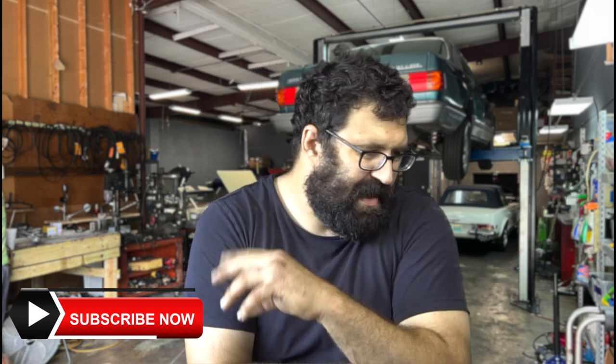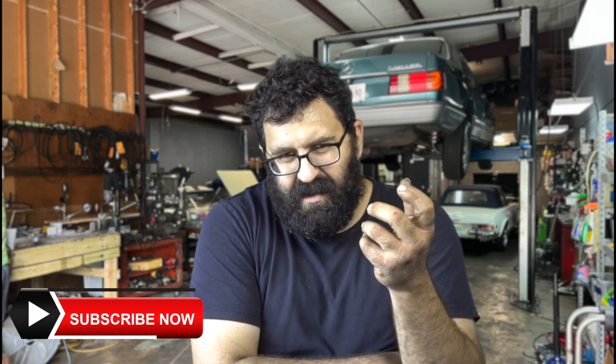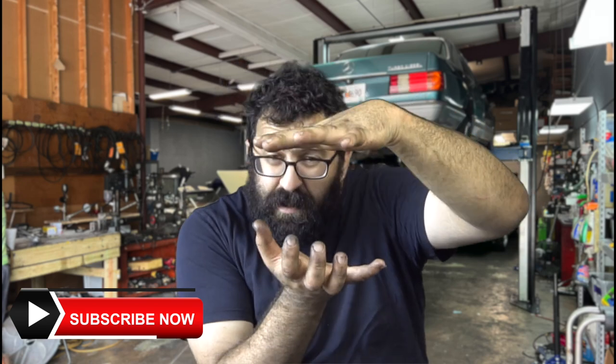We're going to start with the first most common issue, which is a dirty fuel tank. When I say dirty, I typically mean rust, because these electric fuel pumps were used exclusively in gas cars. When there is rust, there is failure of everything that touches that fuel. If you remove the inlet on your electric fuel pump, whether it's an original tall pump or a March of '69 or later short pump, you will find a little screen in the inlet, and you have to clean all the rust, debris, and sludge out of the fuel pump inlet.